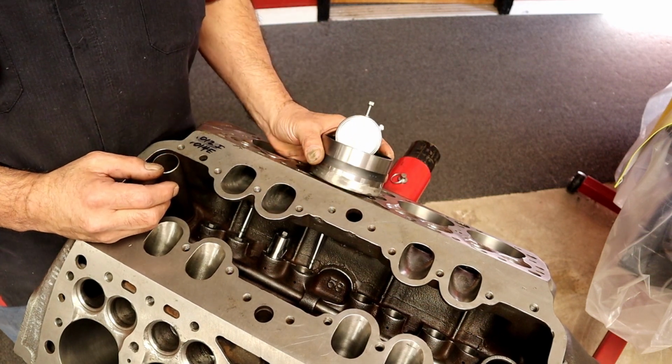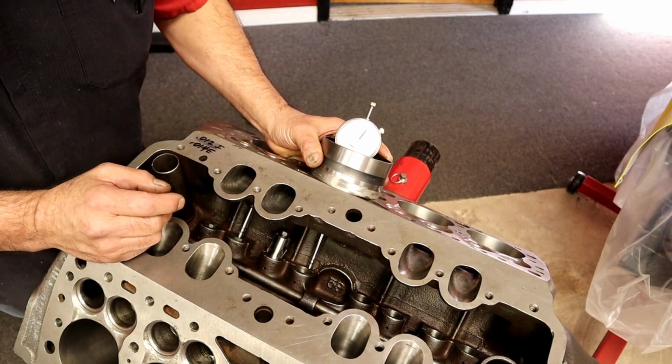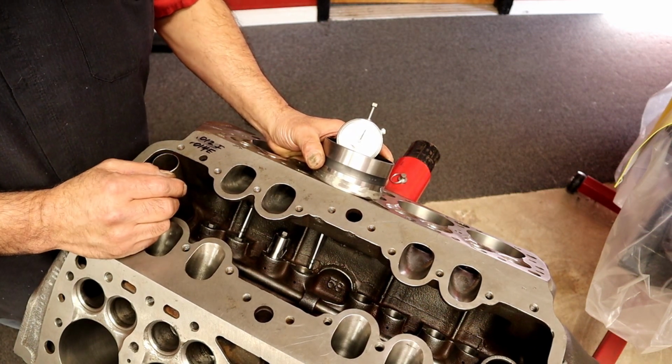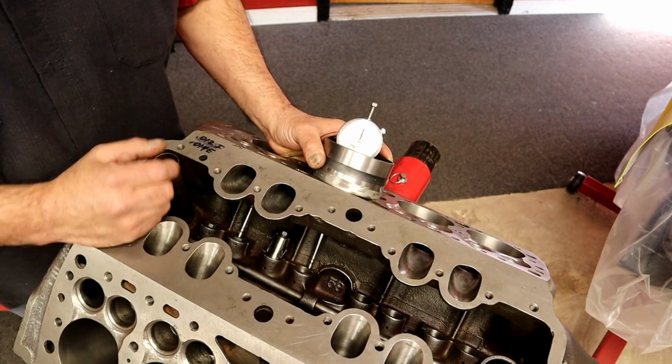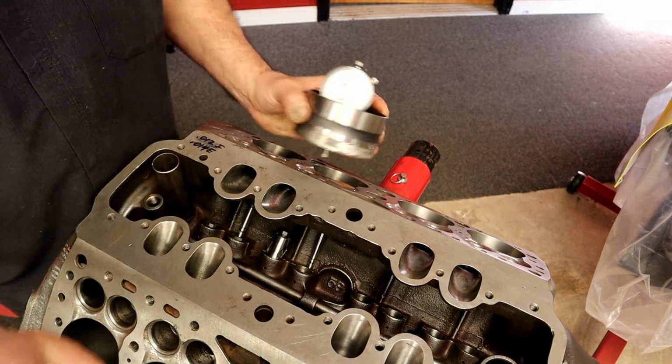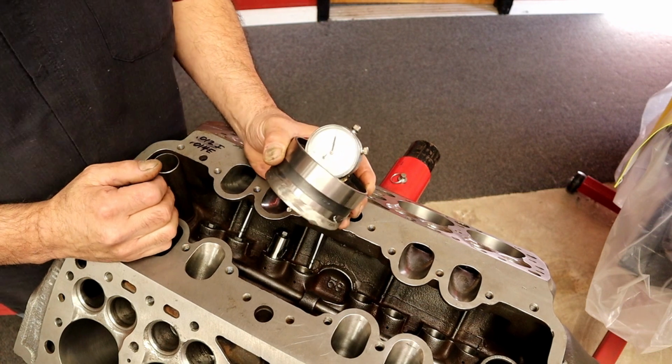I know it doesn't matter, and everybody's going to say, it's a flathead, Danny. Why did it take you 2 years to build a flathead? Well, if you're going to build a flathead, you're going to build it right, and you're going to blueprint it, so every single valve is the same. If you know flatheads, you know one side of the engine is not the same as the other. But they're all the same.